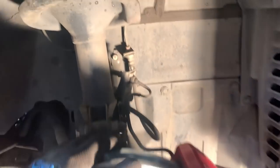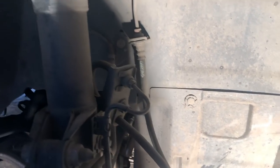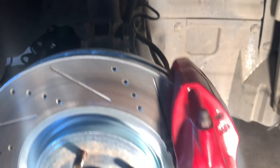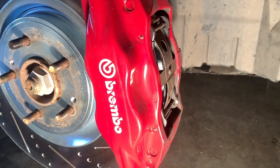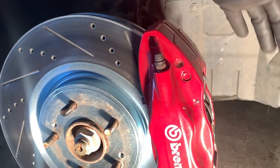Let's get some more light in here. This is all hard steel, so we're going to have to separate it right there. This is what we're replacing - those flexible lines. It comes into the back and we'll separate there. Pretty much the standard Brembo brakes. We'll tap these out, the whole thing comes out and then the pads come out. We're going to bleed via these nipples here, and there's one in the back. We need to make an AutoZone trip because there's a special wrench I'll show you once we pick it up.